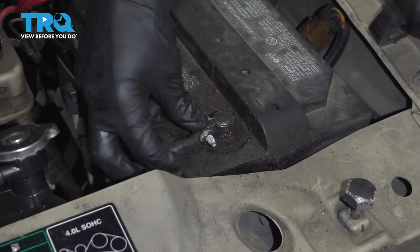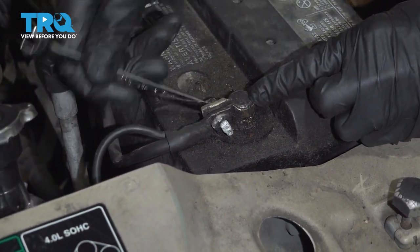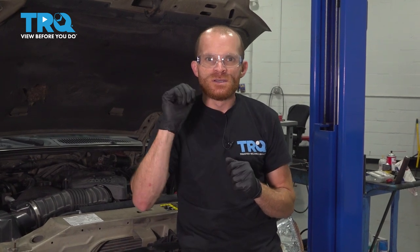Let's go ahead and reconnect our negative battery terminal and make sure it's nice and snug. We got our steering column back together. Now at this point, you're going to want to make sure that you test its functionality one more time. Put the key in the on position, run it through all the gears. After you're sure that it functions properly, go ahead and put it back in park and turn off the ignition. Start it up, run it back through the gears — as you get into reverse, make sure it starts backing up; put it in drive, make sure you go forward. Aside from that, go ahead and take it for a road test and I recommend checking your alignment. Thanks for watching.